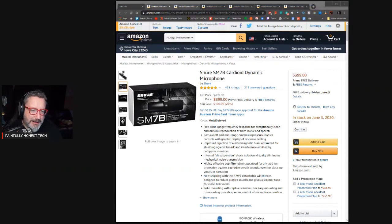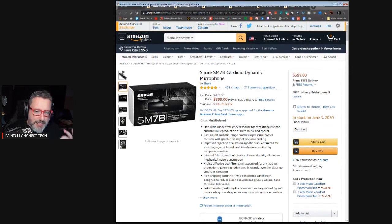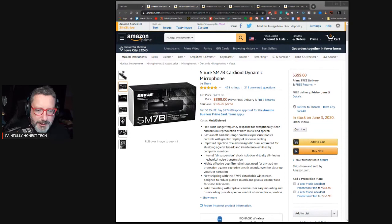Now this is something that's interesting, and not a lot of people might know this, so I'm just going to mention it if you happen to be here listening thinking about gaming. A lot of people will stream. They'll have a streaming PC that is what sends all of the material out into the world, and then they'll also have the PC that they game on. So these days you can usually do it with both, but some people use a streaming PC, and if you want to get the sound that you've got going on with the Go XLR out to that PC right here, you've got this 1/8-inch line output that you would then plug into the line input of your motherboard. That's where the sound would come from for your stream, and it'll go out that way. That's a little deep in the weeds, but it works.